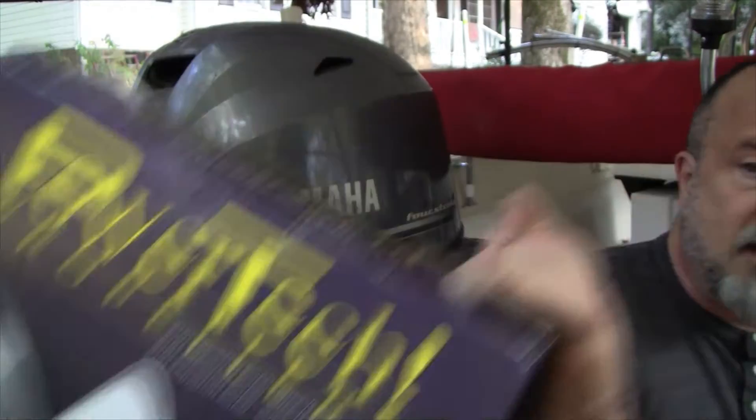I did a little research and Yamaha does make a prop for this — I'll put the model number in the description below in case anyone's interested. Problem is it's a little pricey: about $450 on a good day if you can find it, but realistically more around $550. So I did a little homework and found that PowerTech makes a stainless prop that is for all practical purposes identical in width — 13.5 — and pitch by 14, to the prop recommended for the Yamaha F70 and the classic Montauk 17. I'm going to go ahead and try that and see how it works out.